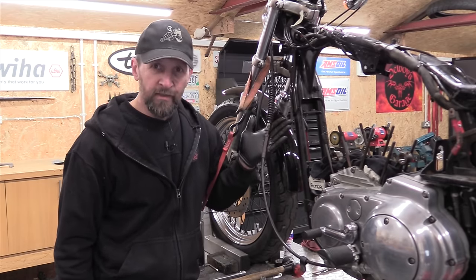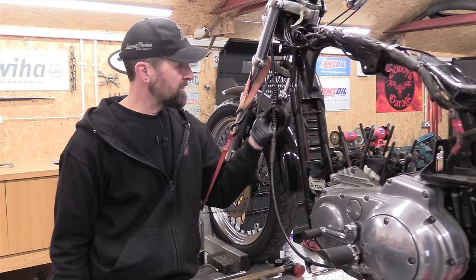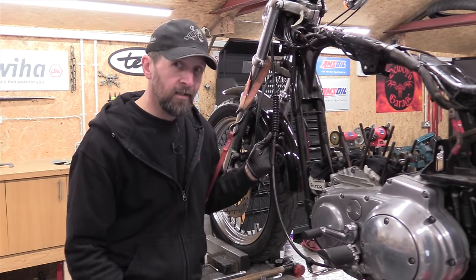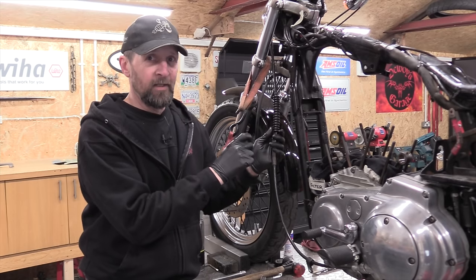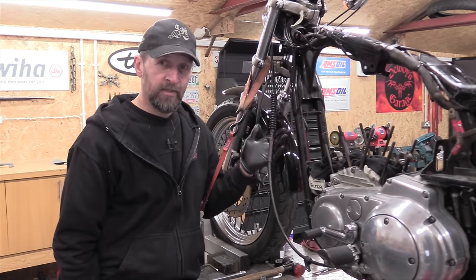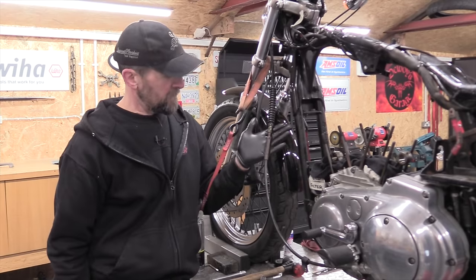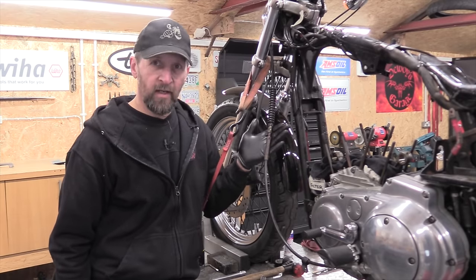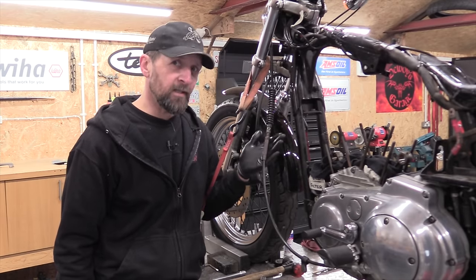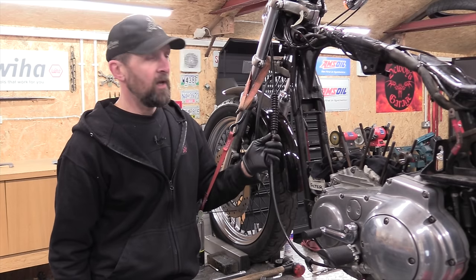Now that is a crying shame — it truly is. I've seen a few like this in the past and it's just a little bit of neglect. It's where you don't take the trouble to squirt a little bit of maintenance spray down inside that boot. Or better still, if you can, spray some lithium grease down in there, or just grease it up by hand and slide the boot back over the top and keep it checked. Because seriously, that's an adjuster bottle screw and you need to adjust it often. When it's a big blob of seized, solid, corroded rust like that, it's useless — the cable's useless and now I've got to replace it. So if you don't want to be replacing expensive cables for no reason, take the trouble to grease up the adjuster under the boot every now and again.